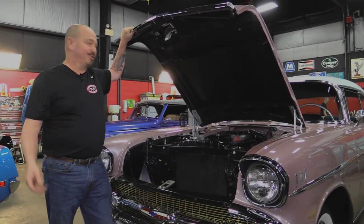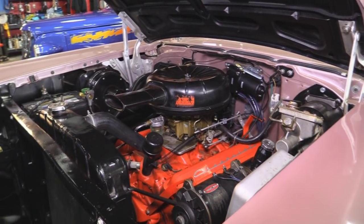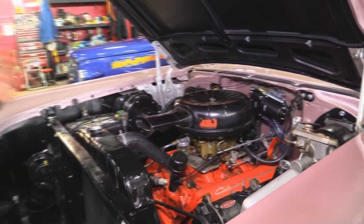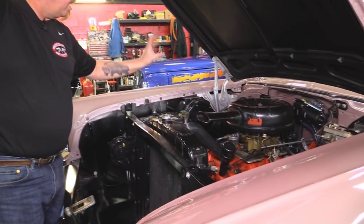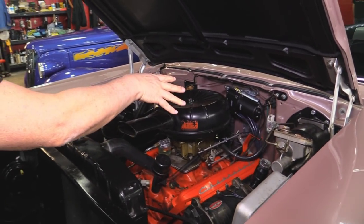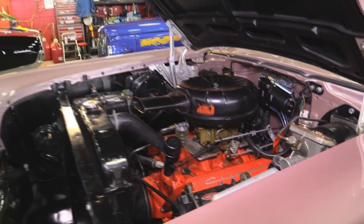Let's look under the hood. She's got power steering and power brakes. She's got the factory original Rochester carb. Now the suffix on the motor tells us that it's a PowerGlide motor — it's a four barrel motor — and the date code on the motor is also 57. So we're almost positive that this baby is the original motor for the car. The radiator's in great shape, we've got a Delco battery, and all the heating stuff is here. A lot of these cars had all this stripped out. We've got a vacuum canister here. Nice paint on the firewall. Looks like it's got a brand new wiper motor on it. All the ignition looks good, the wiring all looks great. This is one beautiful 57 Chevy — you just don't find them like this with a date code correct motor, trans, and rear end.